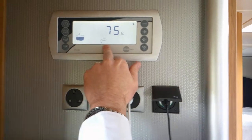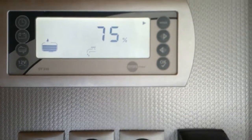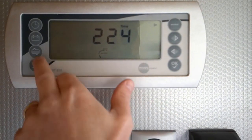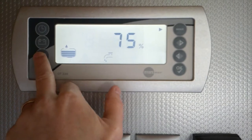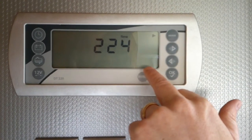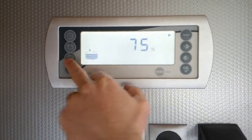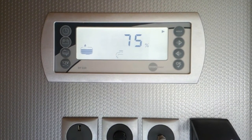You may notice you have a picture of a tap here — this is the symbol for your water pump. There is actually no direct button for your water pump. To turn your water pump on or off, you have to press the water gauge symbol first, and then press OK. You will then lose the tap symbol and the water pump is turned off. To turn it back on again, press the water tank level symbol and then press OK, and that will activate the pump. The pump works by micro-switch — as you open a tap there is a small click and that turns the pump on to pressurize the system. The tank is not a gravity tank — you have to have a pressurized pump to pump the water through.